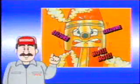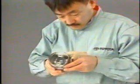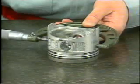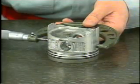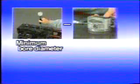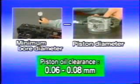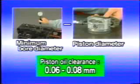If the engine overheats, or if the crankshaft does not rotate, each piston must be checked for damage and deformation. First, using a micrometer, measure the piston outside diameter. With the piston upside down, measure the piston diameter in the thrust direction, 38.5 millimeters from the piston's bottom edge. Subtract this measurement from the minimum cylinder bore diameter measured in the thrust direction. If the difference exceeds the permissible range of 0.06 to 0.08 millimeters, replace the piston or the cylinder block.